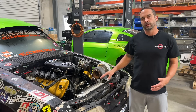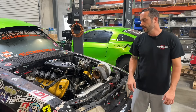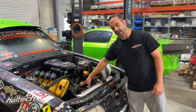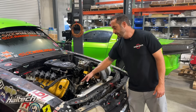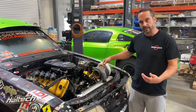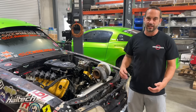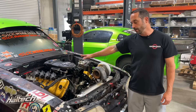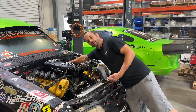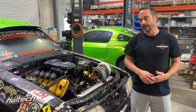The Toro had an electric water pump and no expansion tank, and it had a problem with hot spots in the head — it would crack the exhaust port. The coyote is known to crack an exhaust port if it's been overheated or has hot spots, so it's a common issue if plumbing is wrong. The electric water pump was mounted directly to the fitting adapter, and the radiator in this car is lower than the engine, so your fill point is lower and air pockets build up. You may not know you have a hot spot depending on where your coolant temperature sensor is — water there reads normal temperature, but back where the air pocket is it's extremely hot and you won't know until you crack a cylinder head.